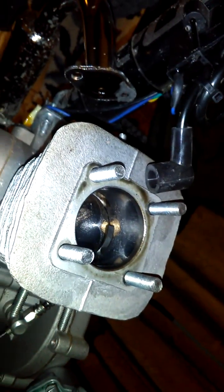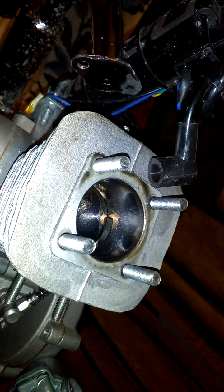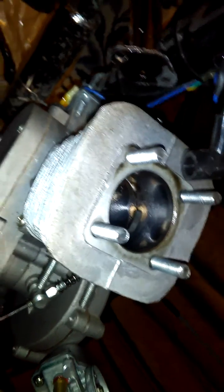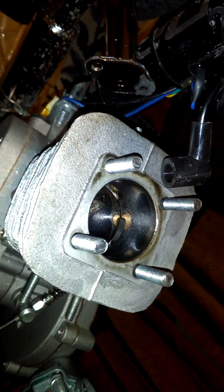What I'm doing is I'm going to take off the lower piston ring. I've seen people say they've done it — they get some blow-by and a few other things happen, but I've heard it increases the RPM and gives you more revs out of the engine. It should rev up faster because there's not as much friction from the piston ring against the cylinder wall.